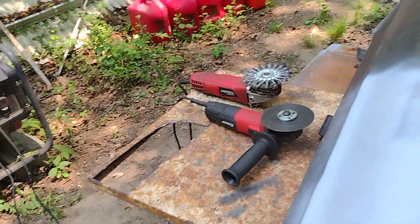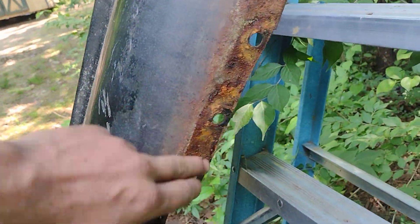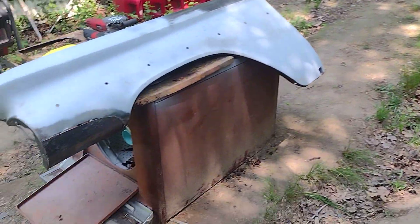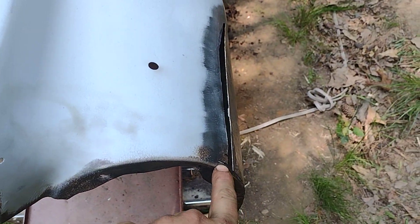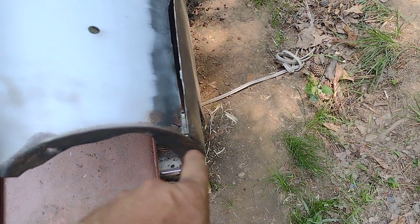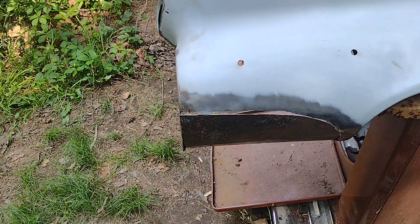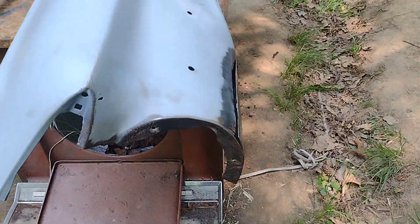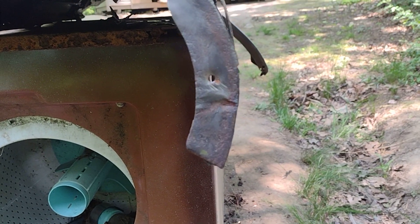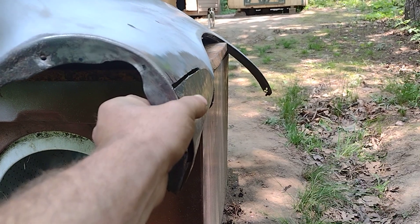I know it won't be perfect but I'll try and see if I can get that part too — we'll see. I figured I'd try and get these curves right first, and we're getting there. I cut right up to the edge on this side, and I left this one — didn't want to disturb that area because it's pretty solid. I just want to come in here and get this curved up so we get our body lines fairly close. It's a piece of 20-gauge, so it's a lot easier to work with.